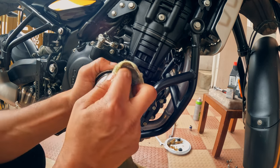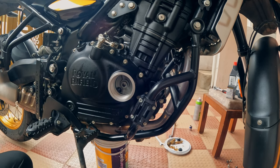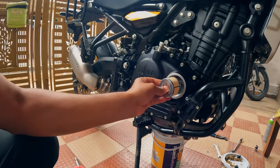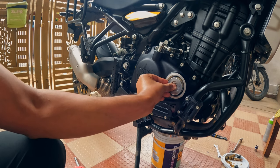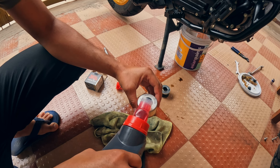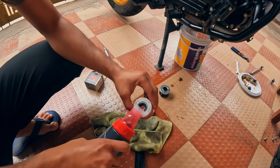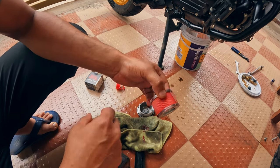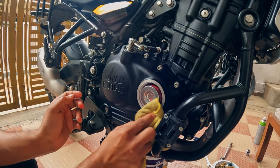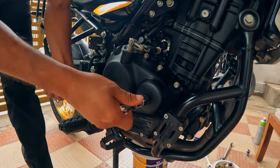Clean the cap as well — this is a very important step. Then simply insert the spring and it will get fixed. The next step is to install the oil filter. At this point the oil filter is completely dry, and if we install it like this the engine might run dry for some time, which is not good for any engine. So the idea is to pre-fill this oil filter with some fresh oil before installing it, so that the engine never runs dry. Rotate it so the filter gets completely soaked in the oil, and add some more oil if required. Once the filter is completely soaked in the new oil, install it — slide it into its slot and once it is in place it will not go any further. Then insert and tighten the cap.